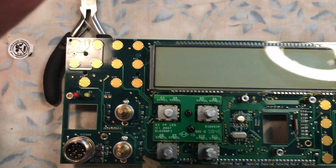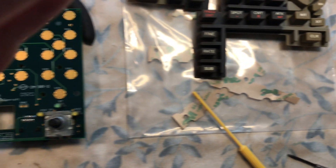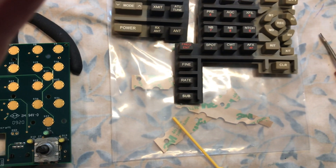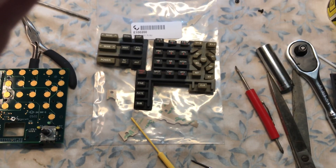When you drop in the new matrix and peel off the actual backing, align the new matrix by the holes as the old matrix was aligned. Peel off the adhesive backing and printed label, and while you maintain alignment as you drop it in, press the surfaces down — then of course you reassemble everything.